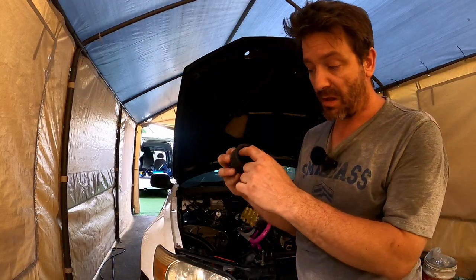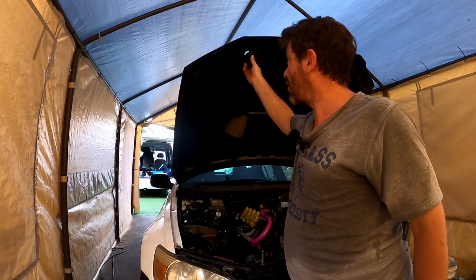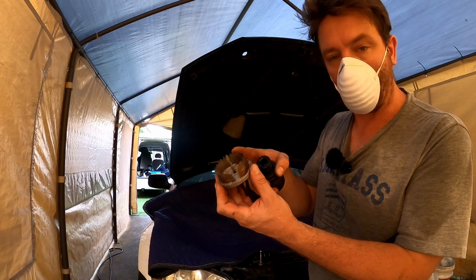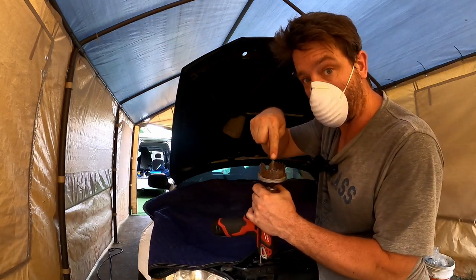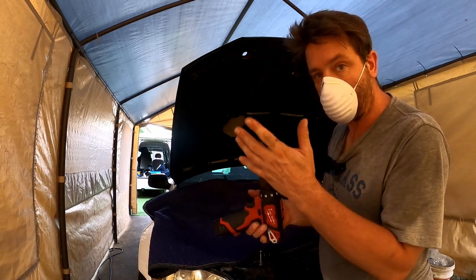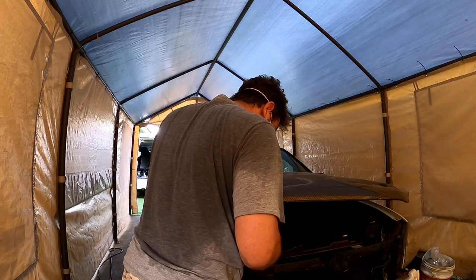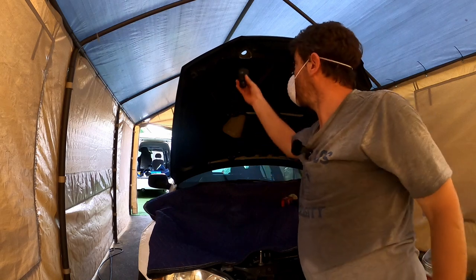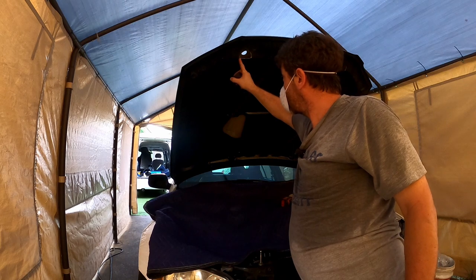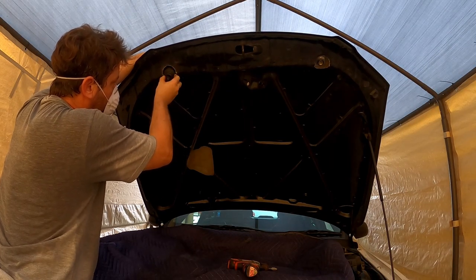Because this is 38mm, it also has the body — I couldn't find a thinner walled one, so this is what we've got. But it doesn't fit in there. I've already done this one, and I'm going to do this one the same way so you can see how I did it. Find a hole saw that fits — I'm using the wood blade, no problem. I'm going to freehand this. I'm going to look at it from the top, line up this with the centre using my eye, and then slowly come up onto it so that the teeth bite in. Once I've got a sort of an edge cut into it, I'll flip the bonnet up and then go in. I've got that out, but that's not enough. Now this fits, but it's not centre of the hole — so I'm going to cut straight down from there and bring it around like that. We're going to use one of these in the drill. Yep, that works well.